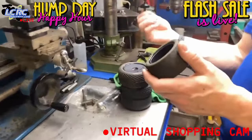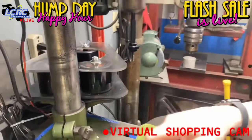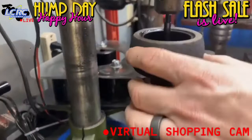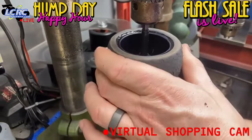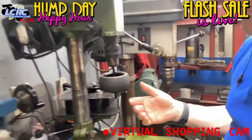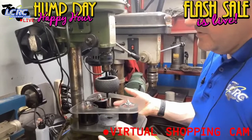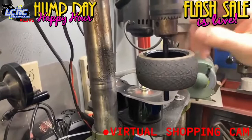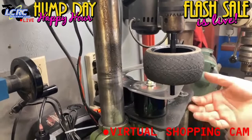In the drill press for the foam roller, I've chosen the J Concepts tire arbor because you can make it go either direction. Some guys believe you have to roll the tire in the direction in which you're going to drive it to have it be the most effective. I roll them all in the same direction, but the J Concepts one — once you tighten up the tire, you can undo it from the chuck, flip it upside down, and chuck the other end in the drill to make it go backwards, since these cheap drill presses don't have a reverse function.